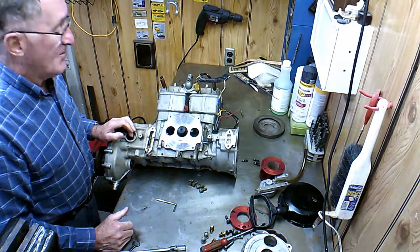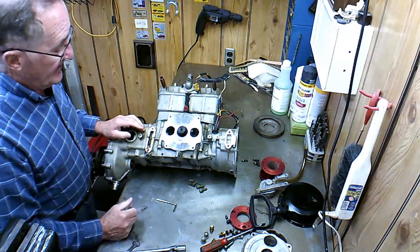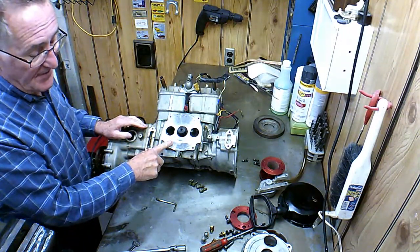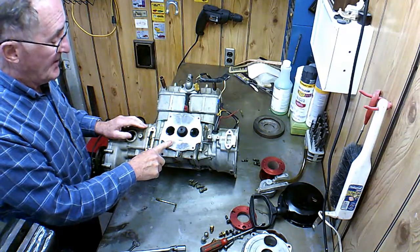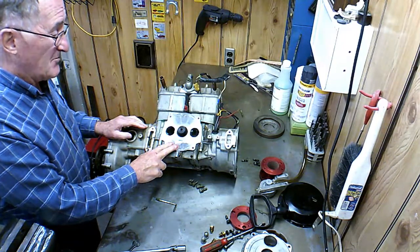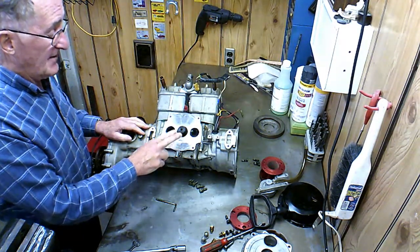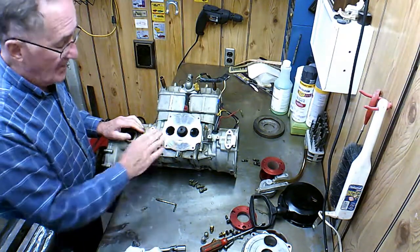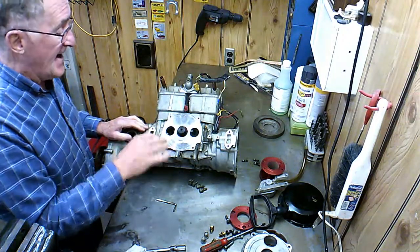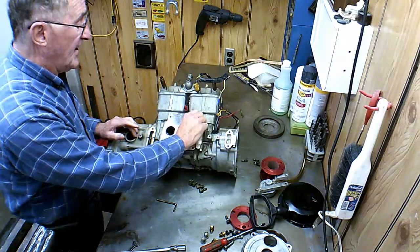So I believe, and this is my opinion, and I'm sure that'll make a lot of discussion, in my opinion, these things never pumped in enough oil on these 582s, and that's probably why you get short crankshaft life. And I would assume you'd get even shorter crankshaft life if it's mounted inverted on the Chinook. This thing was on a Quicksilver, so it was upright, and upside down the crankshaft's going to be on top, and I would think that would be even worse for the crankshaft life.